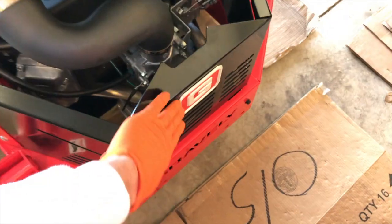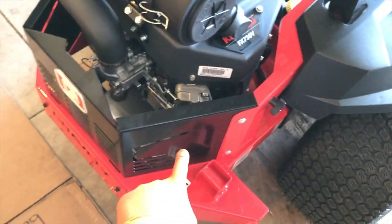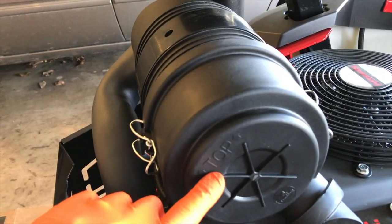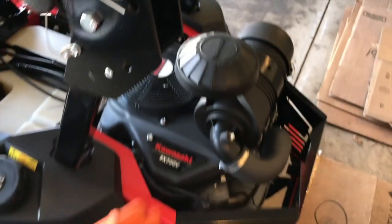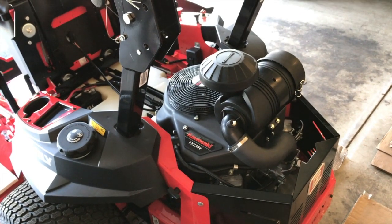On the back-hand side you've got the very famous Gravely logo on a plaque card pressed onto the steel frame, which has grill cutouts to allow the engine to properly ventilate and breathe to alleviate overheating. When it comes time to service, you can remove this entire black steel protection plate — on the inner side there are nuts you can remove to take the panel off, giving you much better access to the lower portion of the engine. Back at the air filter case, you'll notice the word 'TOP' printed there — make sure that's oriented on top. The side cutouts allow the locking clips to secure the cap in place.